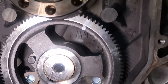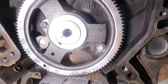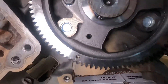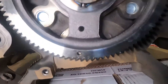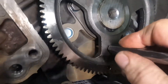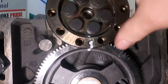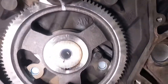If you have one that's scored up, it doesn't matter because the new seal comes with a sleeve — this one came off a bad crankshaft. I put the camshaft in and there's a mark or a hole back there, and a hole in the camshaft that's directly opposite the mark up here. I have a punch that fits in there nice and snug, so when I'm setting the crankshaft down, the camshaft isn't going to move. As I bring it down, it's hanging on the chain so I can manipulate it and get my marks lined up. As you can see, the marks are lined up — that's done.